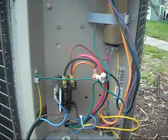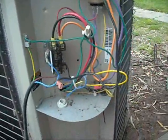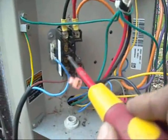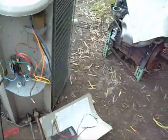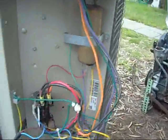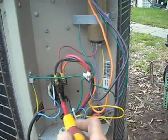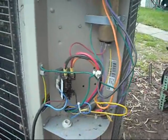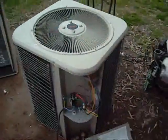It sounds angry - it's not starting. Wait, that's the fan - I haven't plugged the fan back in. The compressor is still not starting. Hello Mr Run Cap, I think you're faulty. Let's try the fan - disconnect first though, then plug the fan back in. OK, now the fan's hot. Oh yeah, that run cap's fried - just vibrating, going out of frequency, it's trying to start, it's spinning. Yeah, buggered run cap.